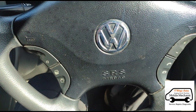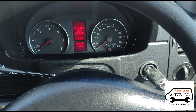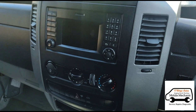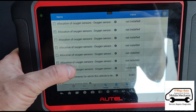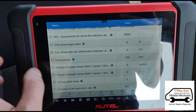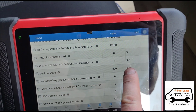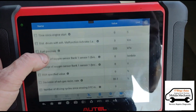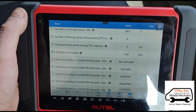As you probably noticed, it's exactly the same van as ours, and I can definitely say this is the first time we've ever done one of these VW vans. We're just going to have a look at what live data we've got on here. Some of these commercial vehicles don't really show you a lot of information. You can see it's only driven three kilometers since the last time the engine management was reset, so I think this guy's got his own diagnostic computer.